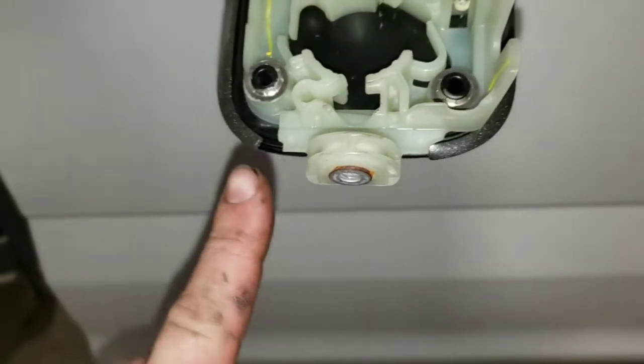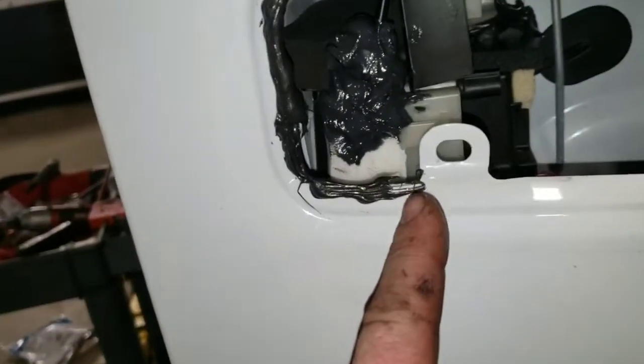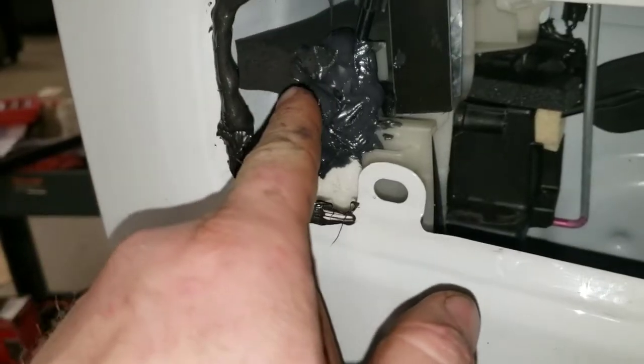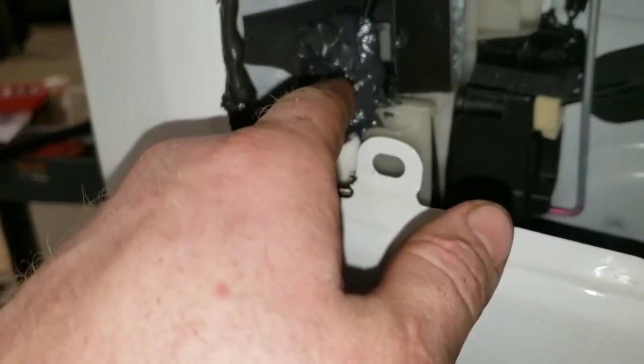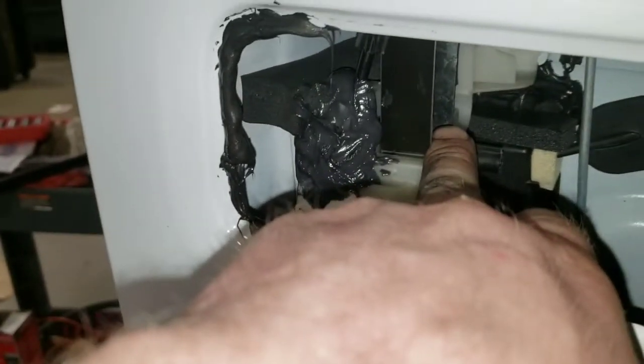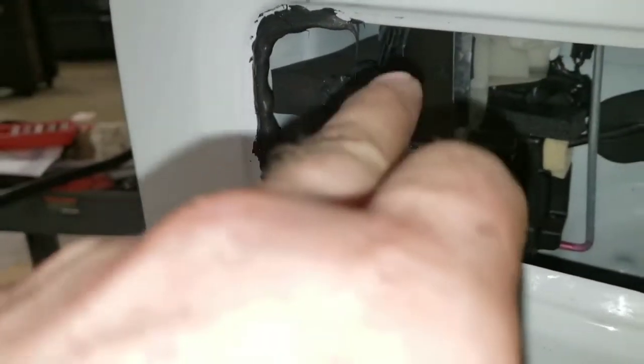I've got my foam inserted back there, the two little metal tabs covered up, and my foam run around my door handle all the way around the new piece. Everything is all greased up nicely. It's hard to get foam back there, so what they have you do is run a bead of TA-30 silicone around this, so whenever that door handle goes back up in there it seals in that silicone. I've got my foam pads inserted, my little piece around the cable, and grease around all of that. So the water stays away from that handle and can't get down inside the locking mechanism. I put the water shield back there as well, and the door will ride up and down that and deflect any water from getting in.